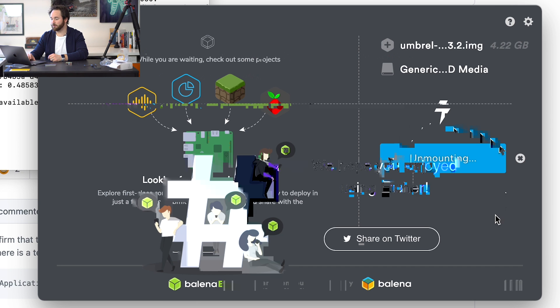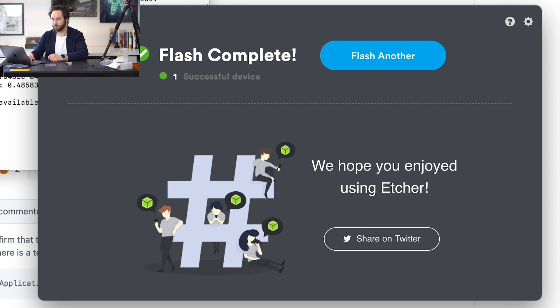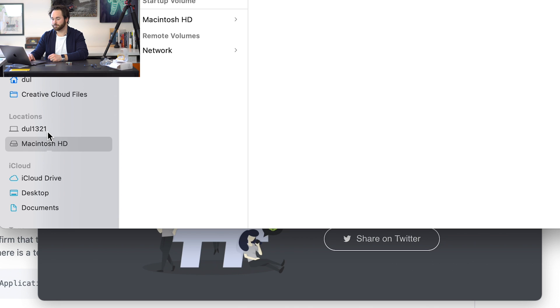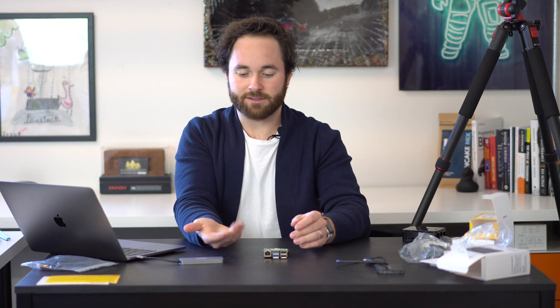While it's flashing, it's important to unplug the power from your Raspberry Pi. The last thing you want to do is corrupt the drive. Then unplug the actual hard drive — this hardware won't be needed for the operating system install, but it will be important to get the blockchain on there later, so set it aside for now. Once you see 'Unmounting,' it should automatically eject, but double check that you don't have any disks remaining. Then remove the SD card and pop it into the Raspberry Pi, just like that.